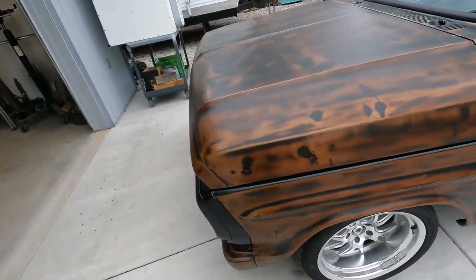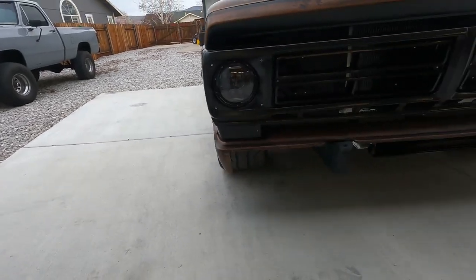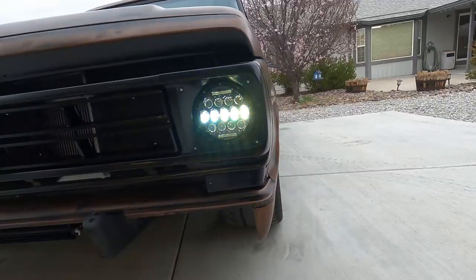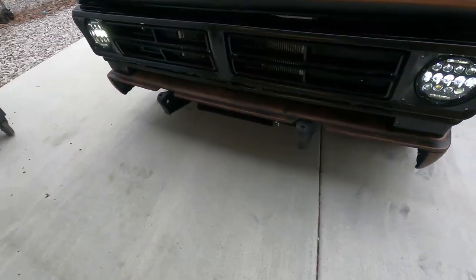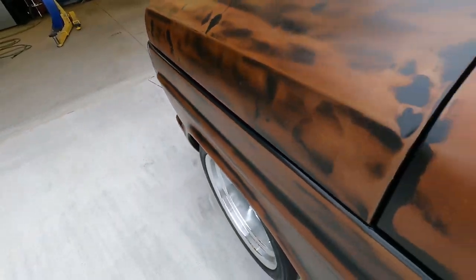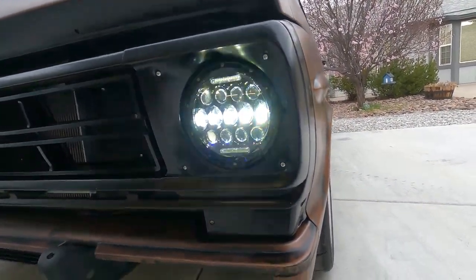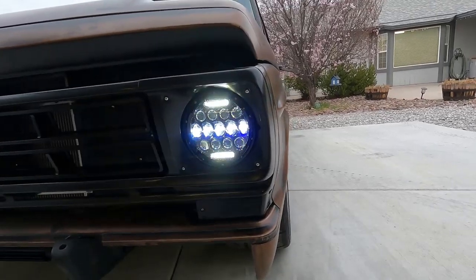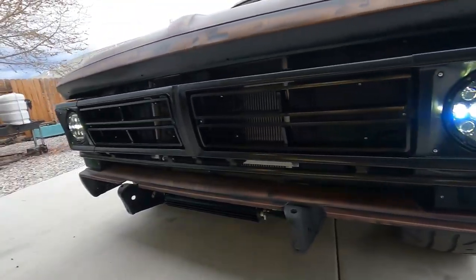Starting off at the front of the truck — we got the hood on, looks really good. We got the grill inserts in and some nice headlights put in. These are the black LEDs turned on, and the blinkers are tied into it. We wired the blinkers into the headlight itself because the original turn signal down here was so smoked you couldn't really see the light, so we unplugged it and hooked it to where the running lights would normally be. They look sweet on here.